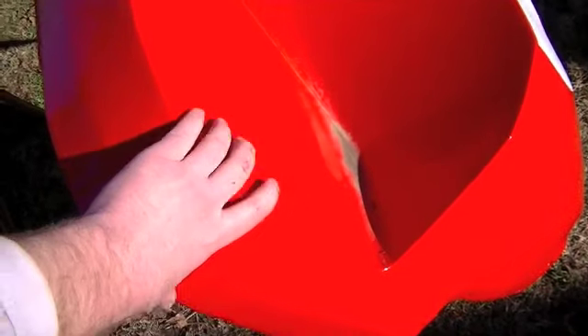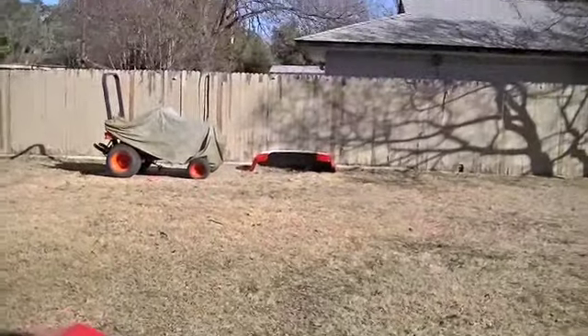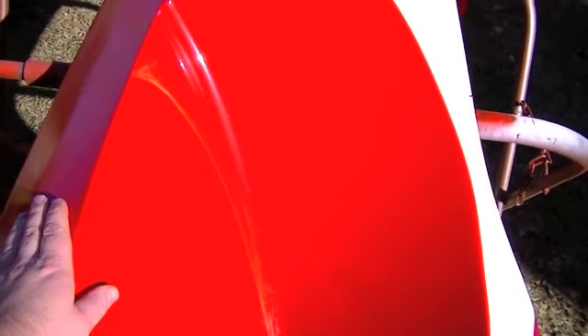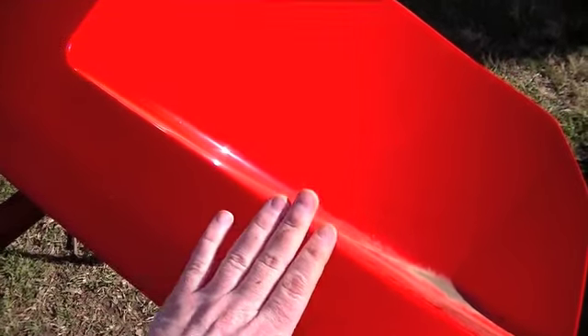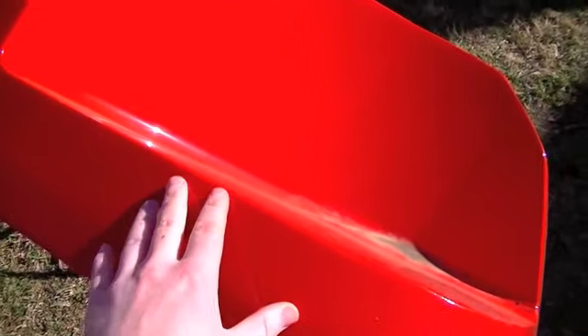This is the safety red, and then I've got flat white. Here is a little insert, and I've got the other fender over there against the fence because I ran out of sawhorses — I've got two of them under the bed. I used an HVLP gun to spray this. A lot of guys like to use rollers; I tried that and didn't like the finish, so I just used my little Harbor Freight HVLP gun. This enamel Rust-Oleum does take longer to dry — it's dry to the touch within about an hour, depending on the outside temperature.